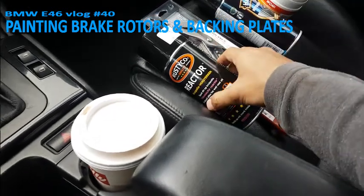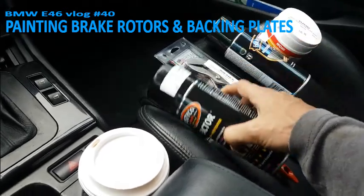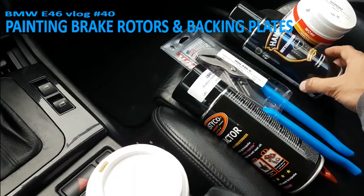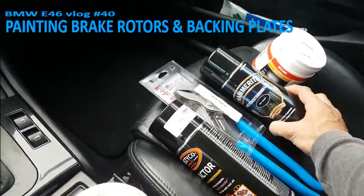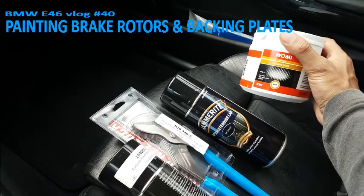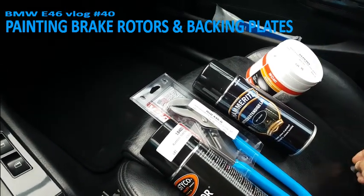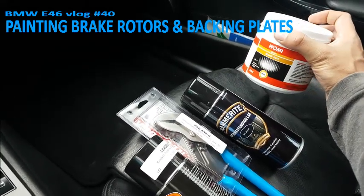Okay, what do we got here? So my rust reactor, you can mix this up with penetrating oil to get everything loose. This one to get the brake cylinder back. This paint is heat resistant and you can paint over rust. Then new little bolts for the braking discs. And I'm going to put the ceramic paste on it, because if you have two materials, the weakest one loses. If you put the ceramic paste on it, you can still get it loose after a few months or a few years.